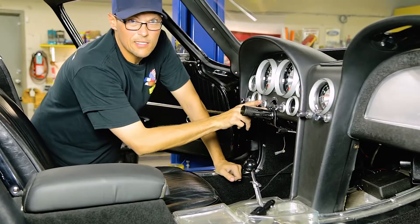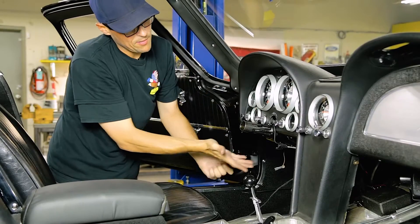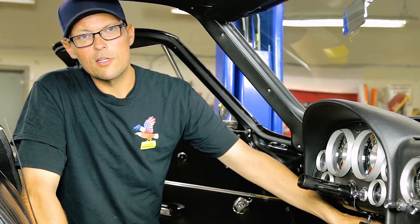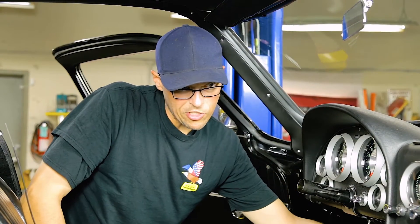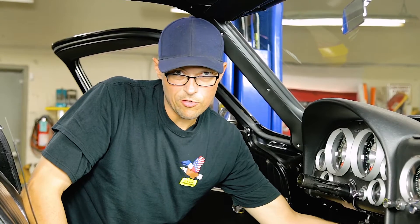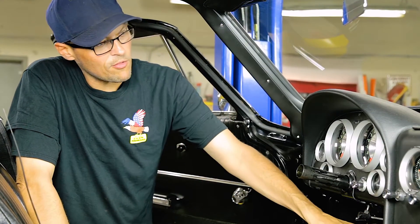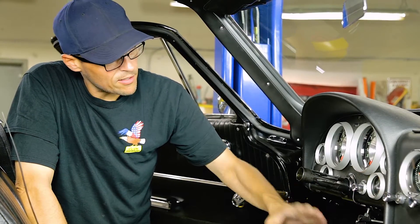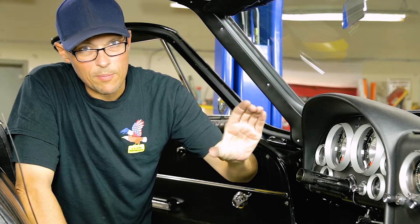Now after this plate is on, we'll need to take the two bolts, put them in through the top, and mount the steering column up. Now that we've installed the electric motor in column, the steering shaft's going to need the set screw put in it. We're going to need to clock the motor, minding the parking brake and the brake assembly. There's very little room, but just move it up and stake the motor.